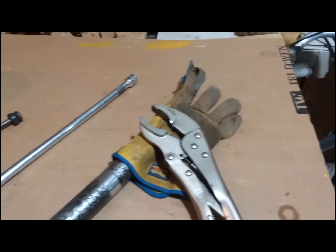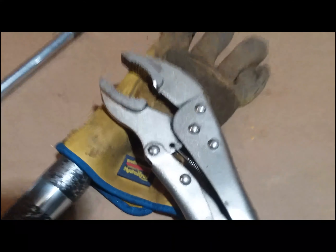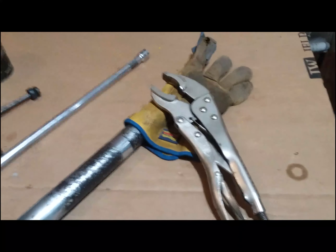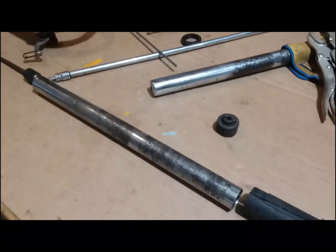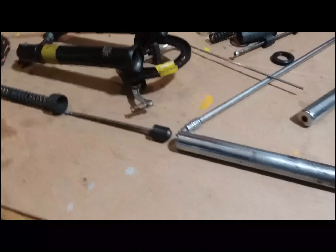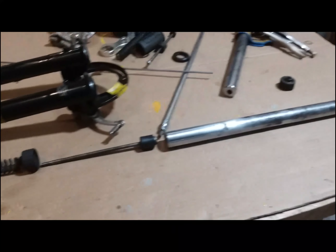I had to put it on a press, which I'll explain a little bit later. I did clean out these little openings for the fork rods or bars. The way I did that is I made myself a wire brush - it was a one inch wire brush and I just welded a piece of threaded rod to it. I was able to clean out inside there and make it really smooth again because it was really rusted in there.